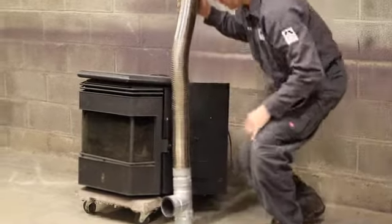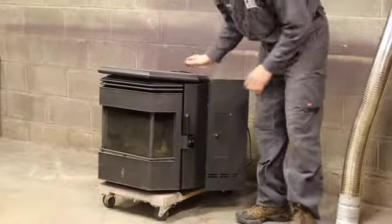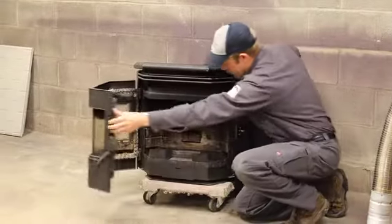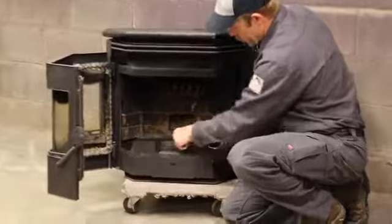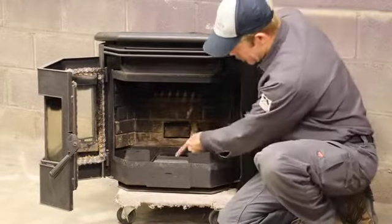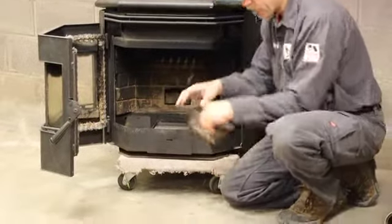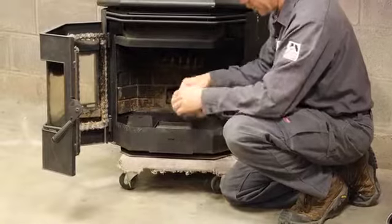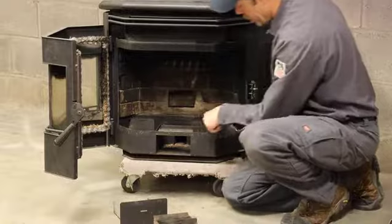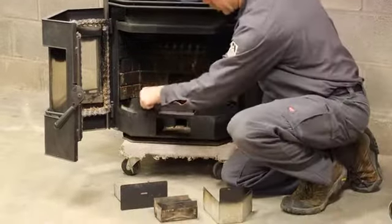This is a Whitfield pellet insert and it has a front door assembly that opens up. The burn pot is a common component — all of them have to have a place for the fire. The igniter is just behind it and feeds through a spot, so if you reinstall the burn pot backwards the pellet stove will not light. There's also a tiny ash drawer, and in this case we have little lift-out panels to collect ash as well.